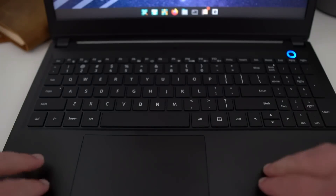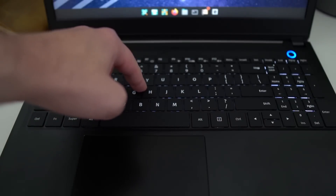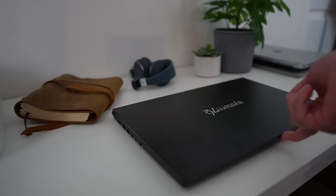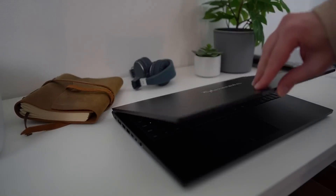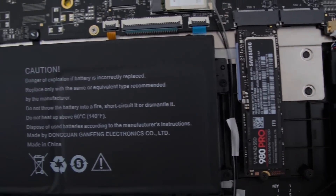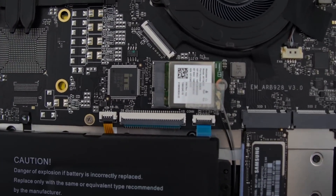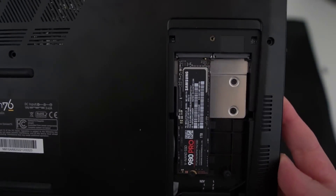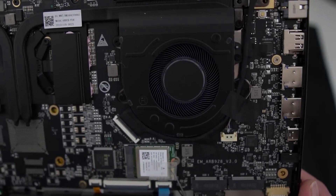The aluminum chassis is robust with minimal deck flex around the hinge or the palm rests and a bit more give in the middle of the keyboard, but it's nothing out of the ordinary. The hinge might look a bit puny but it feels solid. You can lift it with one finger and it has good resistance without wobbling much. The laptop is also pretty modular — you can open it with 11 screws, but if access to storage is all you want, there's a dedicated little trap door at the bottom for just one screw. Only the battery, wireless card and storage are accessible; the RAM seems soldered.